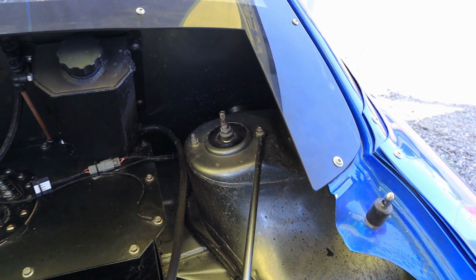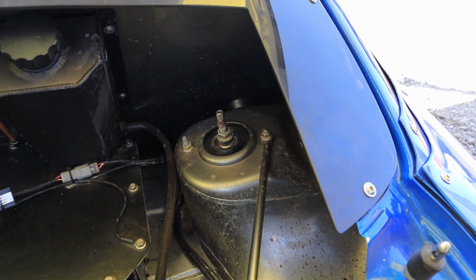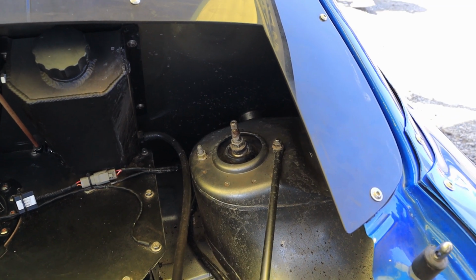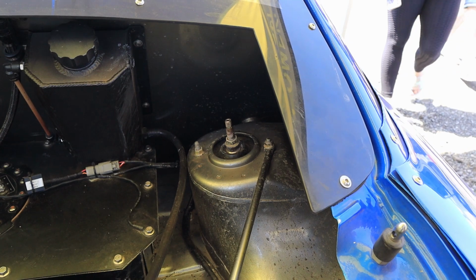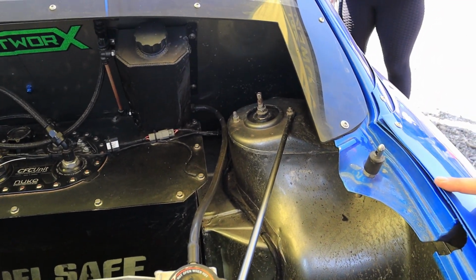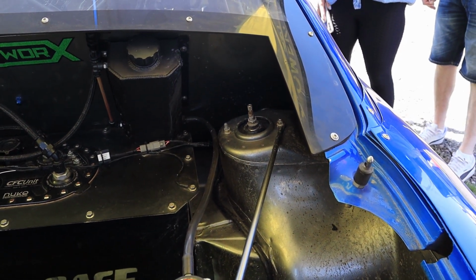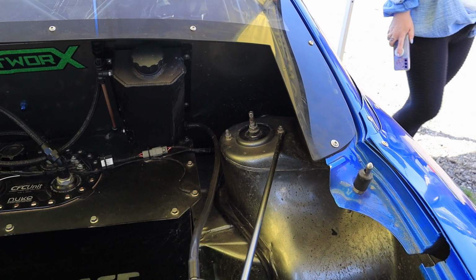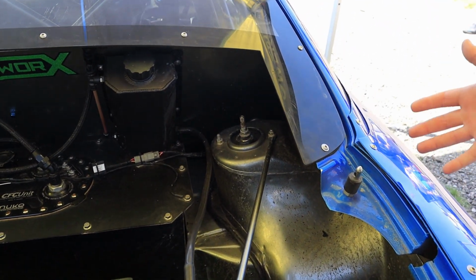And then we didn't talk about your dampers at the front and the rear. Are they a matching set for front and rear dampers? So these are Driftworks CS2 coilovers. Okay. Yep. So I run quite a hard suspension setup on the back, but I run the damping quite soft. A lot of the professional drift cars are running now around about 4 kilo springs. These are actually, I think, a 6 or a 7, so they're quite hard.